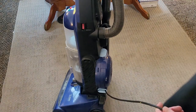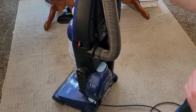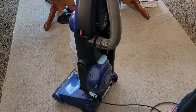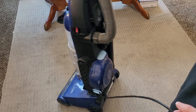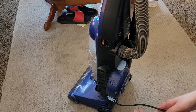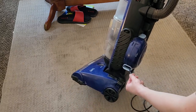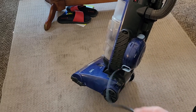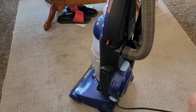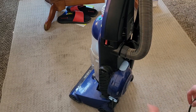Speaking of which, you've got the cord rewind right here. It actually works really well considering it's mounted vertically, similar to the first-generation Hoover Elite Rewind. There's a pedal you can push with your finger or foot to retract the 25-foot cord. Whenever you do this, stop when it reaches the yellow mark. When it reaches the red mark, do not pull it out any further — in fact, pull it in a bit so the red mark is no longer visible. So in practice, you can safely use about 24½ feet of the cord.